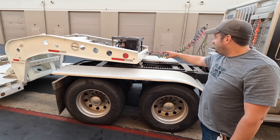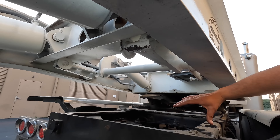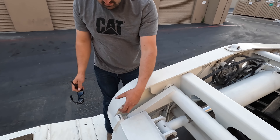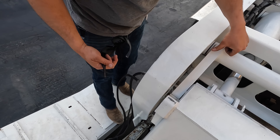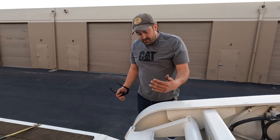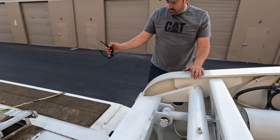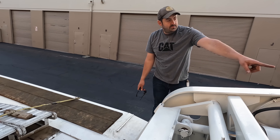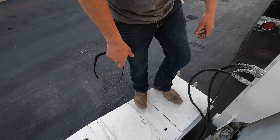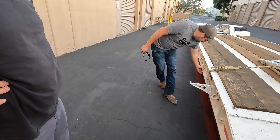We're gonna take off the pony motor and plug it directly into the truck - it's all hydraulic. It's got these little guys - you have to park straight obviously. These come down and rest on the frame. I always wondered what held that up. This will completely lift up. These right here control your ride height - there are about four different stages. You lift it up wherever you want, set it down. When you go to actually set it down, you twist the handle, lift these all the way up, then it lowers to the ground. Once you're on the ground, put those pieces onto the frame and it holds the neck up. You pull this pin, disconnect all this stuff, drive away. This stays on the truck, this goes on the ground unless you've got to do a wide load.